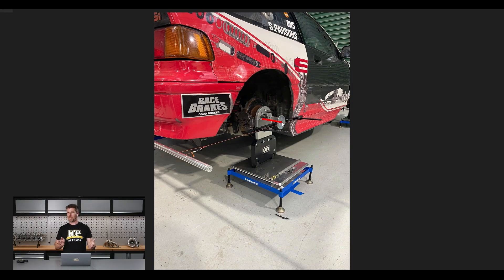The distance between the hubs at the rear of the car might be different to the distance at the front — that's absolutely fine, the track width can vary. We just want to make sure that our strings on the left hand side at the rear and the right hand side at the rear are equidistant from the hubs, same at the front. This gives us a parallel box around the car where we can take measurements. You can do this directly off the wheels, which is the easiest and lowest cost way to get started. You can buy a string kit for probably under $400 or $500, or make your own — it's not rocket science.